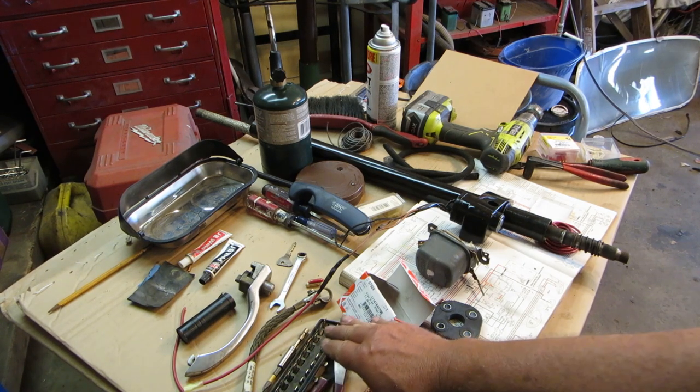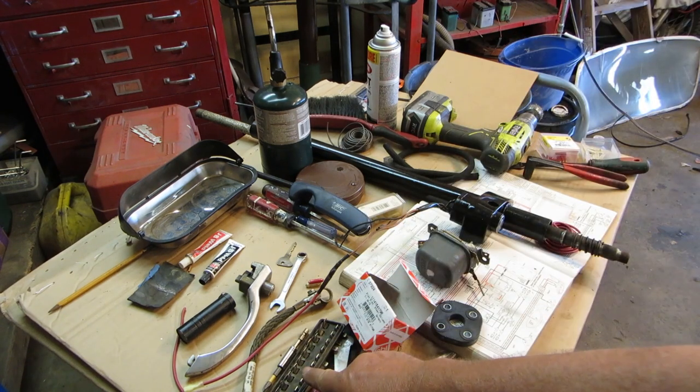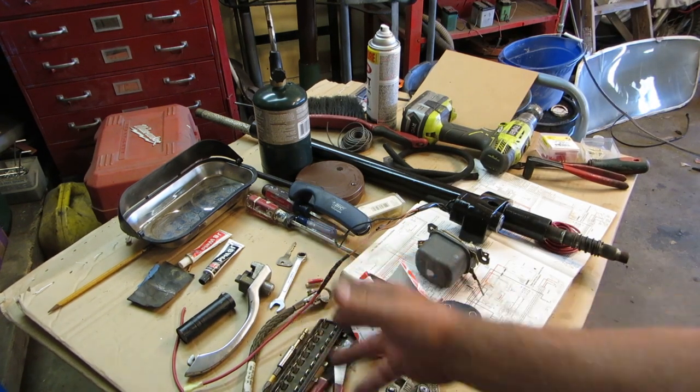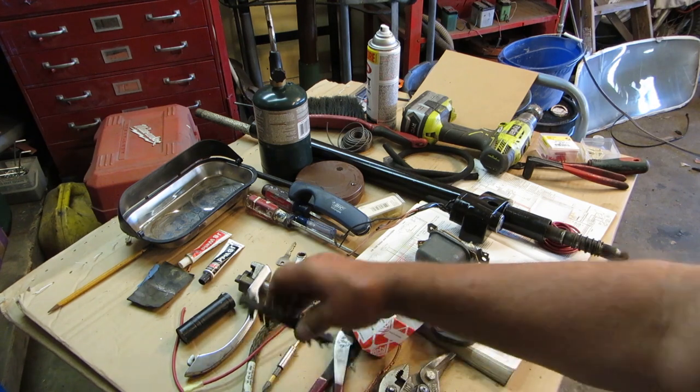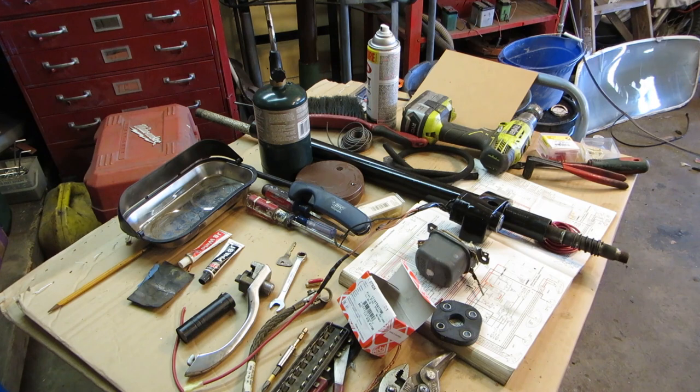When I plug these wires that are coming up from the main harness into this, it's not going to activate anything unless there's a fuse in it, and unless it goes anywhere. So if there isn't a fuse in it, it doesn't matter. I'm only interested in this just to make it start first. So we'll get that working, and then we'll work on the rest of the stuff.